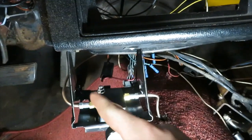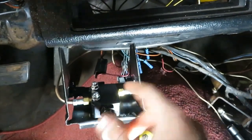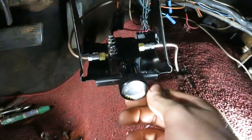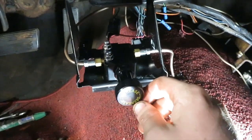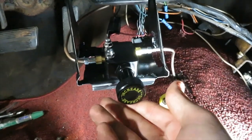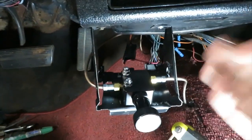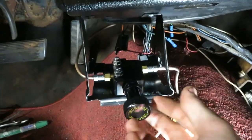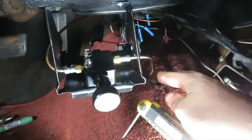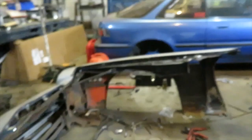We mounted a completely adjustable brake proportioning valve. It comes out of the factory proportioning valve location, in-line with the rear brake line. Basically you can twist it one way or another to increase or decrease braking power to the rear brakes. I call this a burnout knob - you can shut off the rear brakes, do a brake stand, put your foot on the brake and the gas, and only the front brake holds while the rear tires spin.